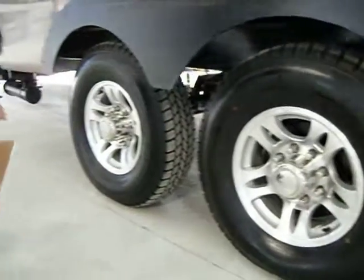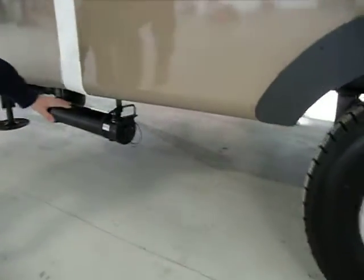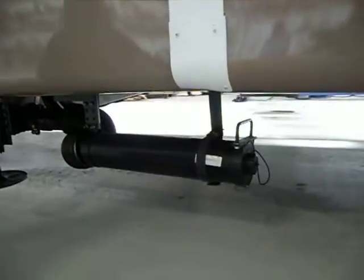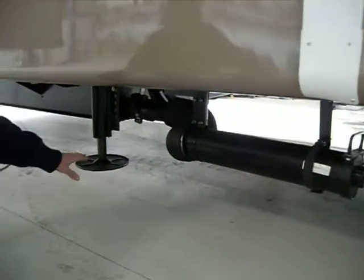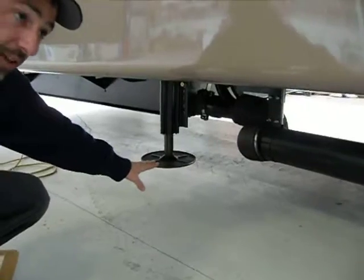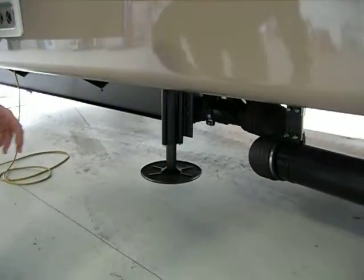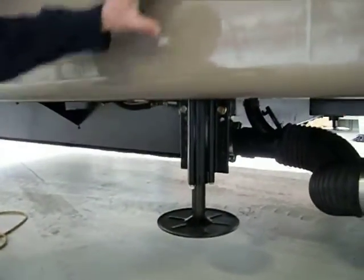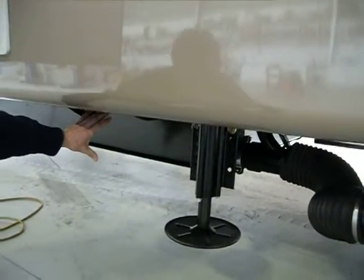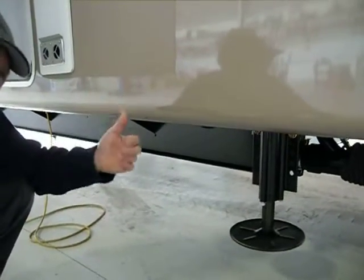As we come along, we can see the area here where the sullage hose wastes black and grey tanks. This here is a self-levelling leg, generally found on the better trailers. And for 2012, they've double-stacked the chassis. It has a 12 inch chassis that runs about this height, and then below it they've added a 10 inch I-beam chassis underneath, which gives a much larger pass-through storage area.